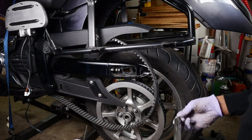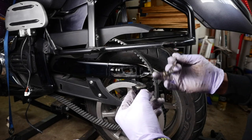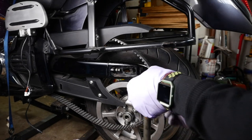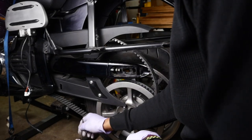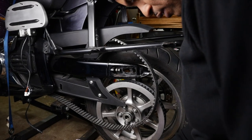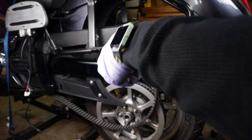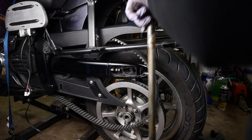And if you have the deluxe bags on, when you actually go to put the axle in there, just put this little plastic plate on first. Onto the front of the axle, put that on first underneath the bag, otherwise you're gonna have a hard time getting it in the camber plate. Now I put a little light coat of oil on the axle, but not on the threads. If it does get on the threads, then just clean off the threads, because you really don't want it on the threads. But on the rest of the axle, that's fine.